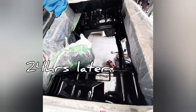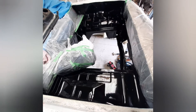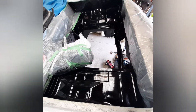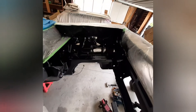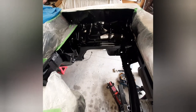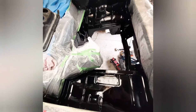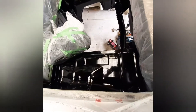It's the day after I've painted the engine bay and as you can see it is still very glossy - it's not supposed to be, it's supposed to be satin. I was hoping it might flatten off a little as it dried, but it has not. Having done some research and read some reviews on this particular paint - which is a single-pot enamel - it turns out it is known for not being as the label reads, stating that it's satin. So I've ended up with a gloss finish.